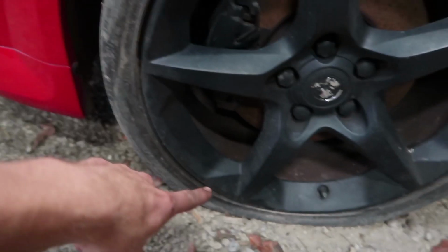I also have a little thing that I want to test out, which is the sports feature, which with this car in particular, when you put it on the sports feature, it hardens up the suspension, the steering gives you more feedback, and as well as that, it also gives it better throttle response. Example, when you put your foot down, your foot actually goes down, whereas the computer normally in comfort mode will sort of gradually increase the accelerator rather than have it just snap on as if whatever your foot's doing is happening. And I also need to suss out why the tire is flat.